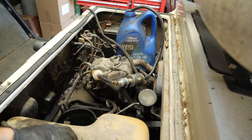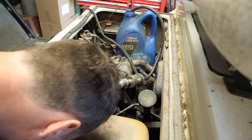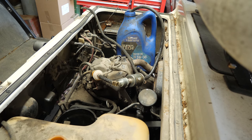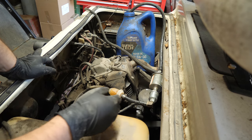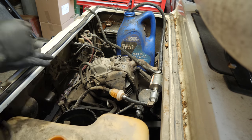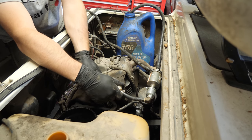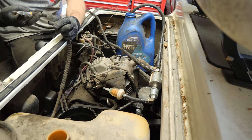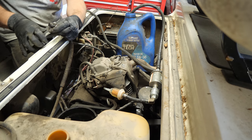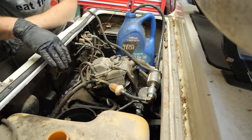Unfortunately there is no just cleaning the carburetor. That tank doesn't even smell like gas — not one bit. I'm going to clip that fuel line right on the end there just because it's all stretched out. You can see how it's all spread out and the end's got some cracks to it. So we'll cut about an inch off. Now it's nice — shouldn't have any more air leaks now.